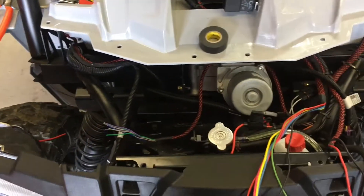Once I get all that wired it'll be pretty much done - there's a lot of wiring. I want to get this at least buttoned up and the cover back on so I can put the door latches back on. I've got to get the relay box sorted out - this blue wire is dead-headed right now for a switch-activated relay. I wish I had more wire color variety. I'll probably use yellow for the clutch blower and blue for the radiator fan.